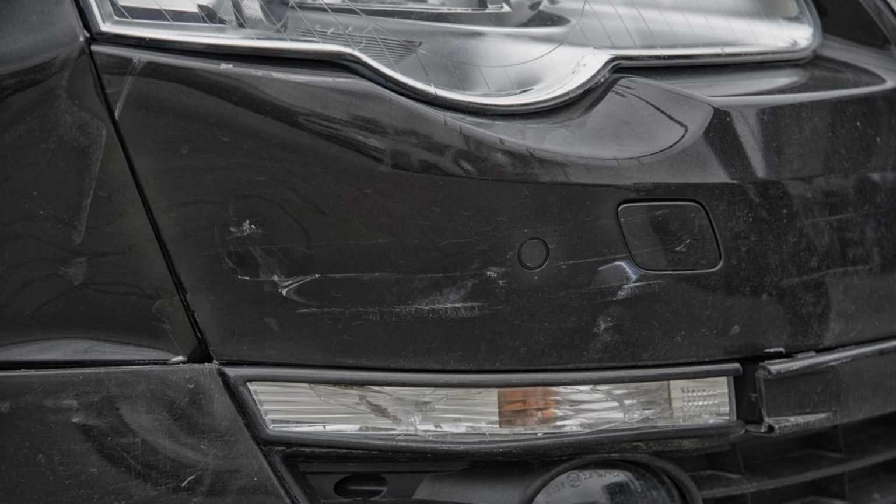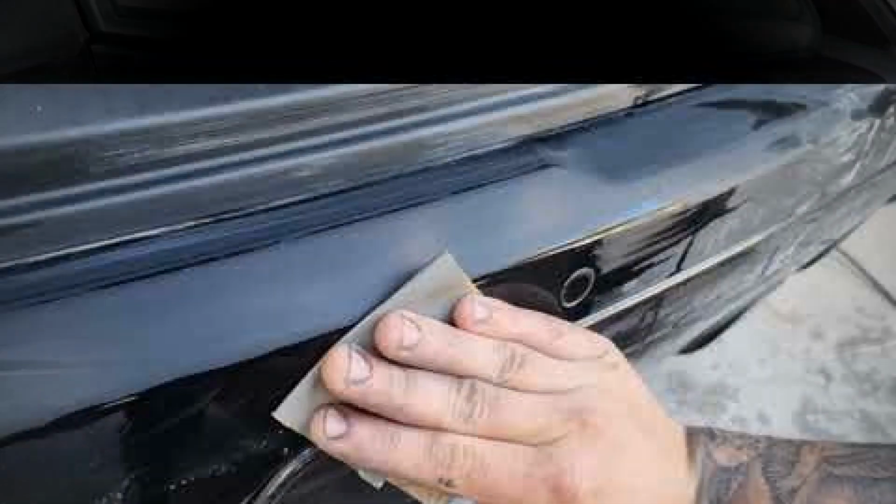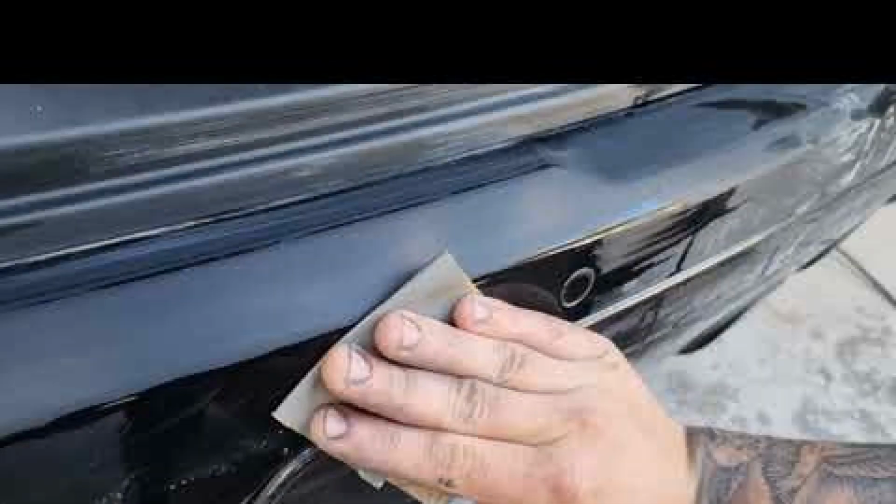13. Painting your car's bumper is trickier than it looks. First, you'll need to apply a wet coat of flexible sealer and allow it to dry for 30 minutes. After that, apply primer and paint over the sealer. Usually, 2 coats of 2-part primer surfacer should work. Dry sand the restored surface with 400 grit paper once hardened.